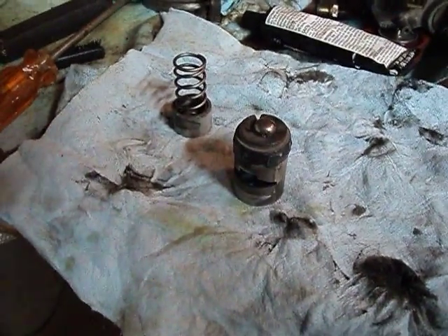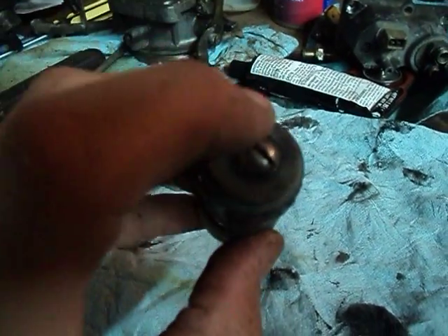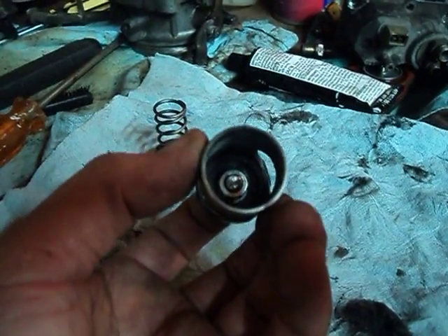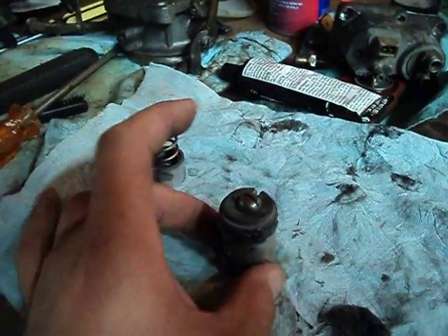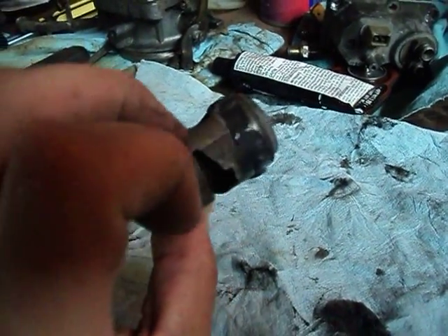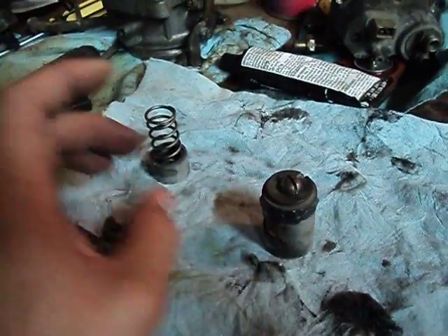Back with the auxiliary air valve. Last time I had a hole that I drilled in the top. Basically what I did was I found the first available screw that fit the hole, dropped a nut down in there, cut it down to size, and sealed it up with a little bit of RTV. I also put RTV around the edges right here since it is a press fit — most likely it won't need it, but I just like to be safe.